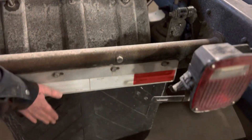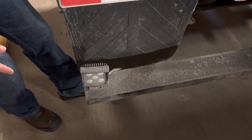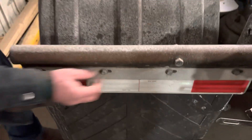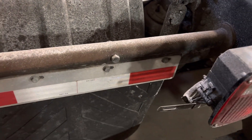Rear vehicle splash guards. My splash guards are right here — at least six to nine inches off the ground, not dragging. They're not torn, cut, or loose, no missing nuts or bolts, and the bracket's not cracked, bent, or dented. The splash guards are securely mounted.